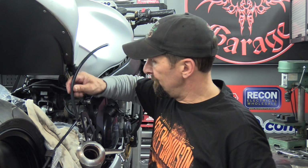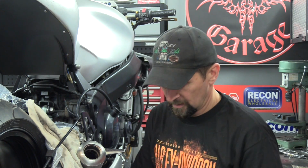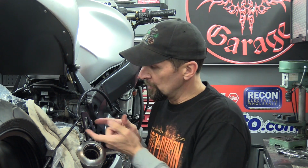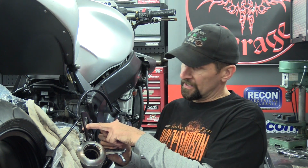Right, there we are, got it, nice and secure. It took a little bit of hairdryer heat and probably an hour or so over this, which is a 12mm bolt, to stretch it just a little bit beyond. And also I put a little bit of red rubber lube on the outside of that union, not on the inside of the hose where it might contaminate the fluid, just on the outside of that little piece of plastic tube.